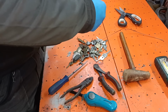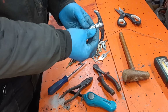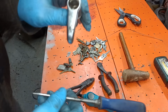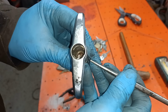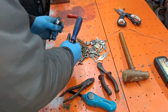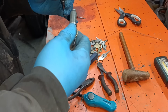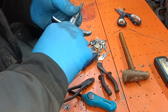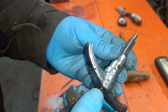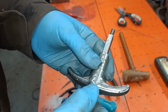Now, if I hold this like that, that little groove thing has to go on that side, like that. Ah, there we are, okay, yeah, that's it. So what you can see down there, look. Can you see that there's that groove which slides across from one side to the other on that plunger? And this little eccentric pin is what engages in that groove. So this goes in here. Now there it goes. So there's the key in the lock. And it does turn and then it slides the pin. But because it doesn't fit perfectly, that's why there's that little scratch part way up the bore.